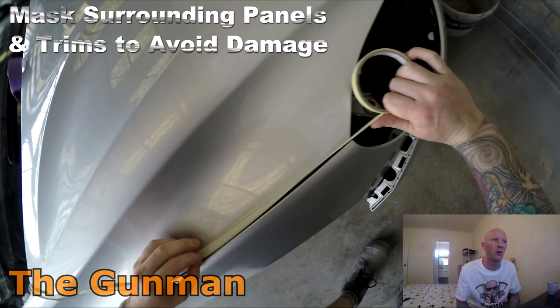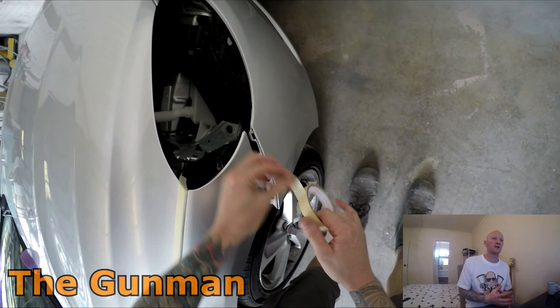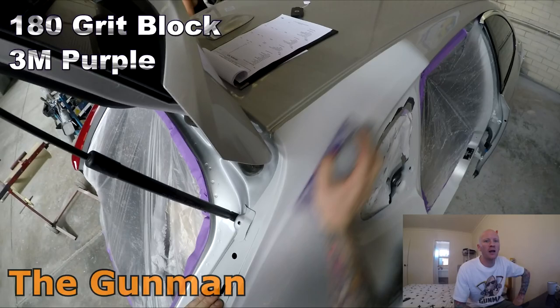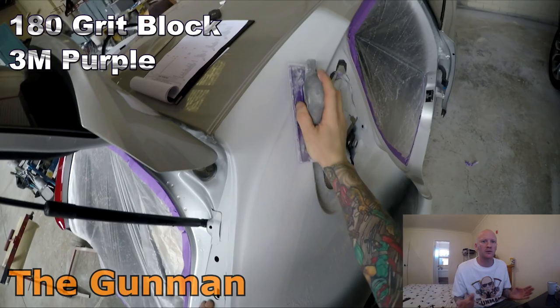If there's any big bits of oil patches or even tar, road grime, stuff like that, sometimes you've got to get either a bit of thinners or even a bit of Prepsol onto it. Obviously, then just going around and making sure I tape up the surrounding areas, any headlights, bumper bars, surrounding panels, to make sure that I don't hit them with my sanding paper.